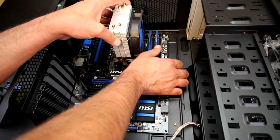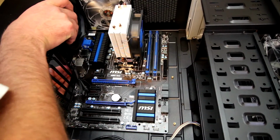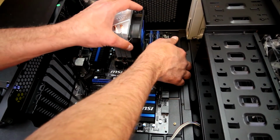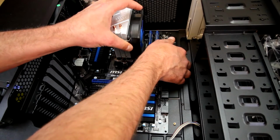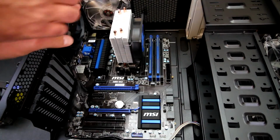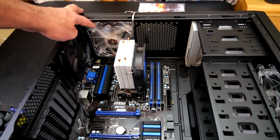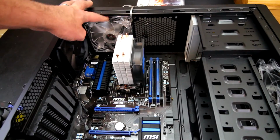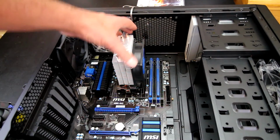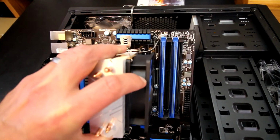And then I'm having an issue lining it up actually. So you go down and double check and make sure. Sometimes the rear I/O doesn't have all the punch outs taken out, so that could be a factor. But I can also see I have an issue with this top mounted fan here. It's actually hitting one of the heat sinks on the motherboard, that top one. Let me see if I can get it out there. The one right up there.